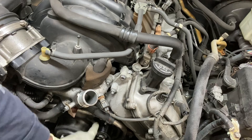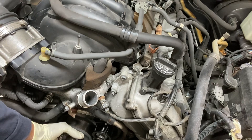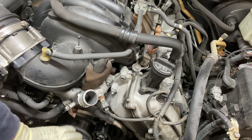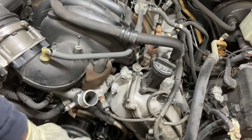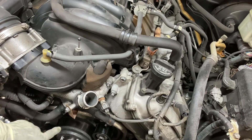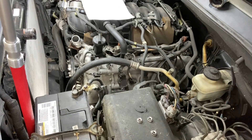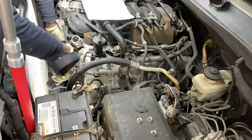It's on — as you can see I can spin it freely and it's tight. This is your water pump pulley. We're going to install back our fan, the shroud, and the belt, but it works in a sequence. Follow me — I'm going to put my belt back on, starting on the passenger side.